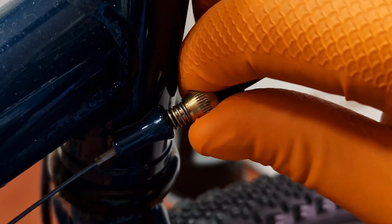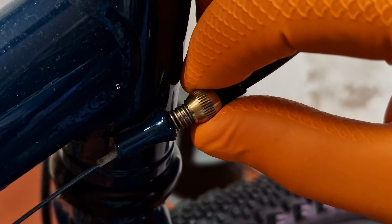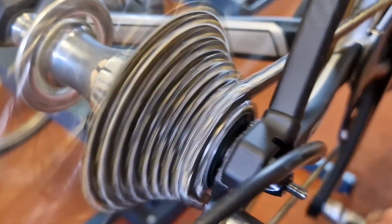The added advantage of not just relying on the derailleur adjuster is being able to adjust in smaller increments, so you can dial the indexing right in. I've set up enough gears to know the smaller increments using the other adjuster can make all the difference to the fine tuning.